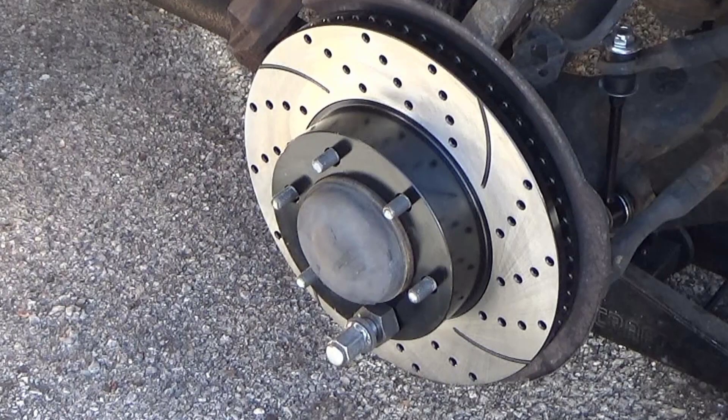I've also been asked about putting a nut on the rotor during reassembly. As you see, I took a thick nut — definitely bigger than the stud — so it could just slide over and put the nut against the rotor. Not everybody is going to have that, so you could use washers. My recommendation is try running a nut up there without a washer or extra nut to space it and see if it'll tighten up on the rotor. However, do not tighten it with a wrench or anything like that — if you jam it down you may mess up the threads. Just use an oversized nut or some washers as a spacer, or try it without.